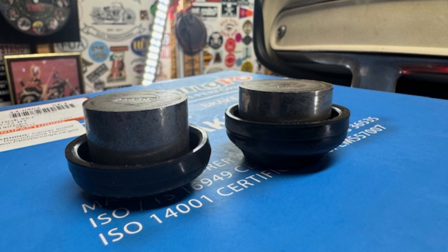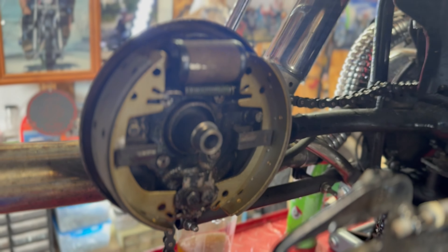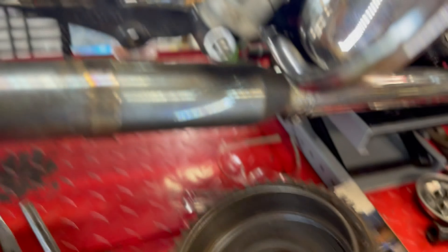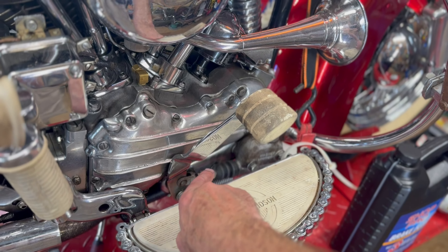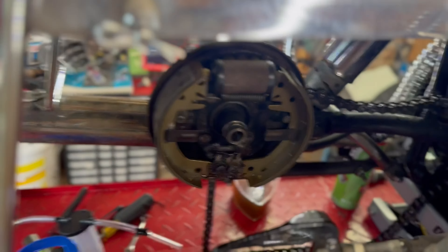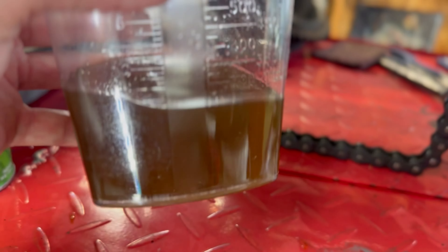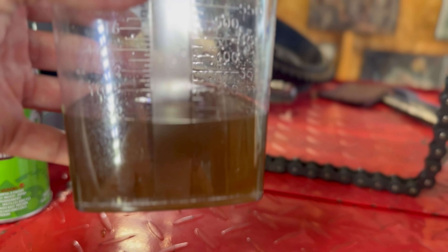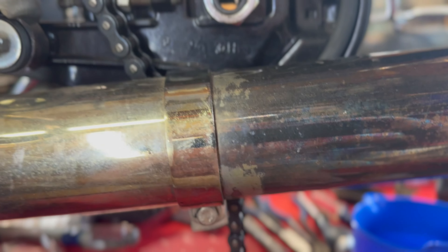Here's what I came up with. I got the new brake shoes on there — I had to remove the pistons from the cylinder and clean them all up, clean the inside of the cylinder too. They were cruddy and nasty. No scoring on either the pistons or the cylinder. When I put pressure on it, I felt something pop and it blew all this nasty cruddy muddy stuff into my little bucket — must have been clogged somehow. Flushing took forever — lots of brown nasty muddy colored brake fluid with a lot of sediment. But now I'm getting clear fluid through.